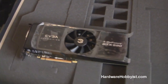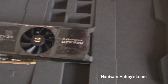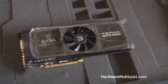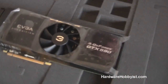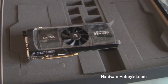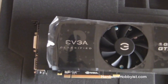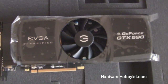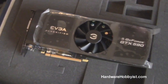If you're going to be using a high-end card such as the 590, you definitely do not want to skimp out on your power supply. Chances are your CPU is going to be high-end, you'll be overclocking everything, and generally pushing the limits of your hardware, so always watch how much power you have. If you're going for gold-rated 80-plus efficient power supplies, 700 watts won't be cutting it too close. But if you're getting a lesser-known brand, I would say go 850 watts or more. For power supplies there's a ton of information online, so always do your research.